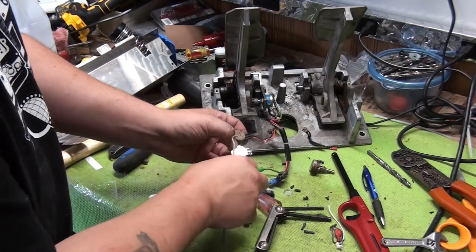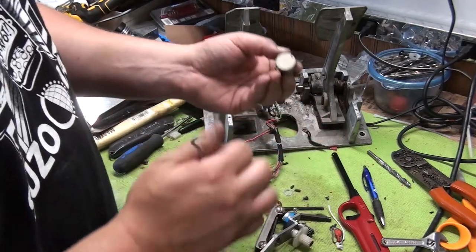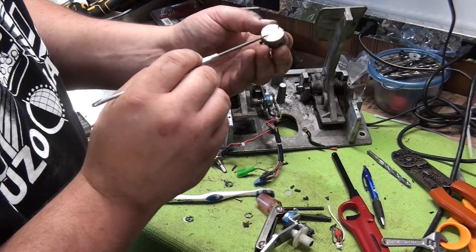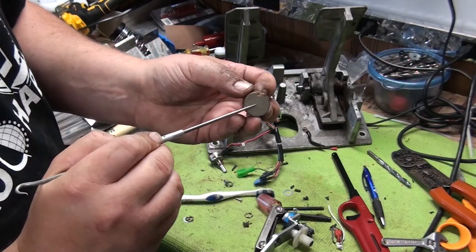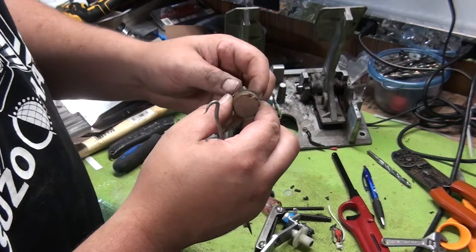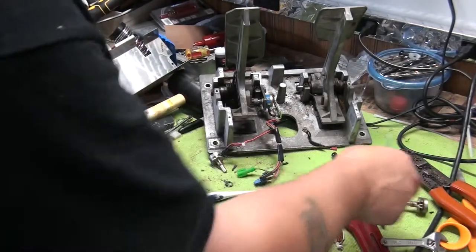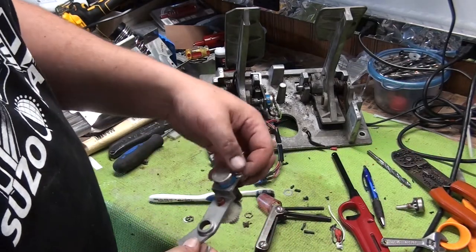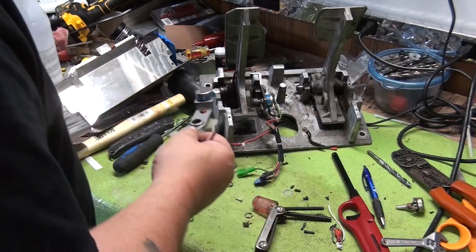And make sure that you're using a 5K potentiometer for Sega games. Depends on how old the game is, but with the Naomi and stuff, you can see on the pot that it says 5K, 5,000 ohms. So at its peak, it's 5,000 ohm resistance to zero. So if you don't have the right pot, you'll have weirdness happening. It'll be either too sensitive or not sensitive enough.